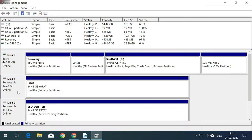This is only for testing. Okay, so I'm going to clone. For example, if this is my existing system, I'm going to clone this hard drive to this SSD. Be very, very careful. If you have more than one hard drive or any disk connected to the laptop, before you clone it or do any operation on the hard drive or SSD, make sure that the target disk is backed up. I mean, it's blank, or you have saved all the data. Otherwise, you can erase all your valuable data.